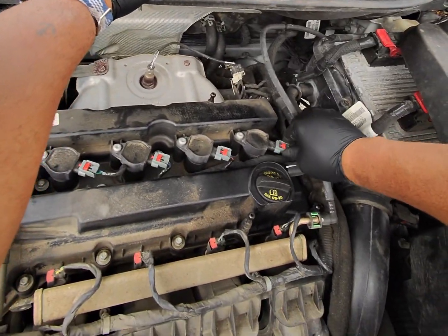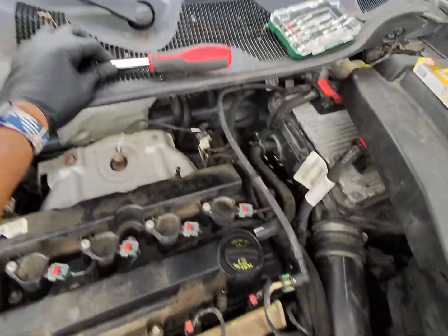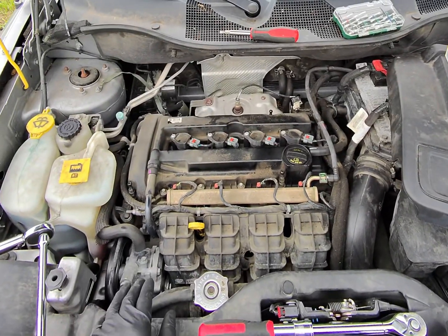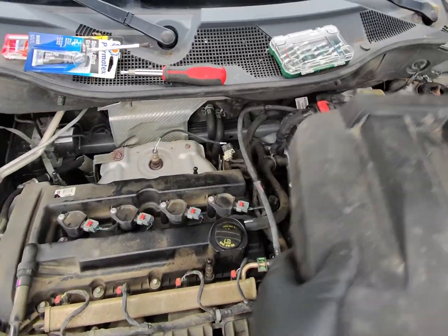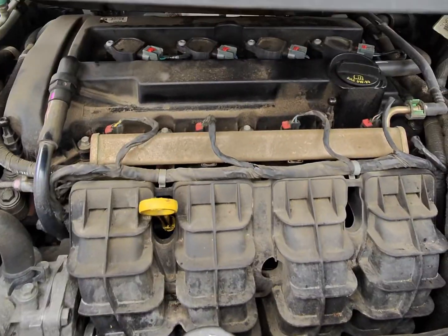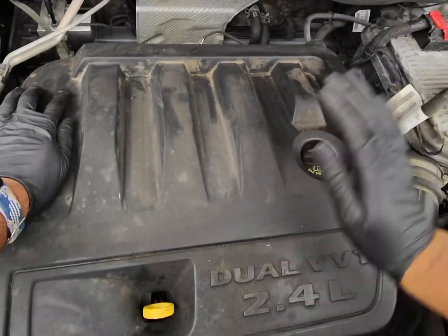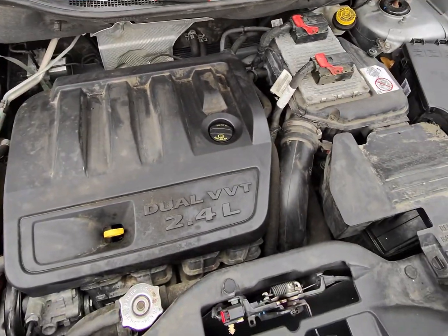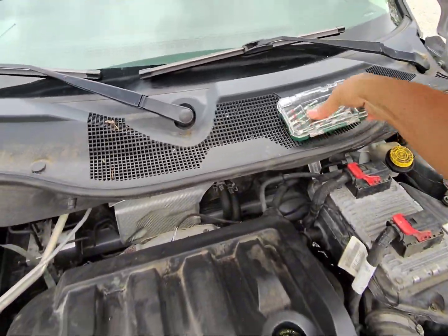This back in. I just noticed this lock is clicked. Plug it in, lock is clicked, and that's it. Changed one spark plug. Now we've got all 4 of them changed in about 20 minutes. So now that we're done, I'll put the cover back on, line those 2 pins up, and it's down. And you're done. I'll clean up our mess before we actually start the vehicle because we don't want anything to fall in.